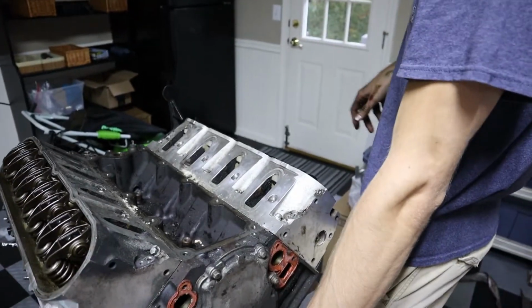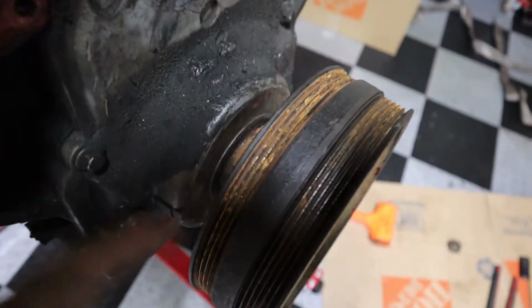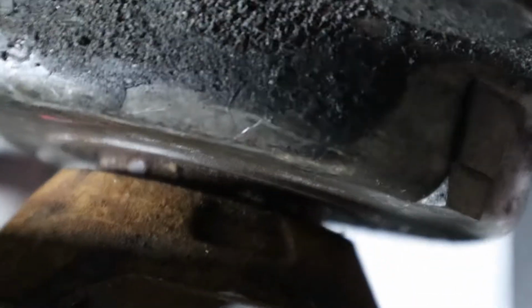Well, I have to drive all the way back down to Harbor Freight. Yeah, that's true. So we're gonna head to the store quickly and go pick up a proper gear puller, because the one that we got from Harbor Freight is a bit too bulky and clunky. Apparently we were doing it wrong, because in order to pull the pulley itself, we were gripping it by the edges, but actually if you look down here, there's notches. There's three notches for three arms. So that's how you properly pull it out. So we'll go get that and we'll be right back.